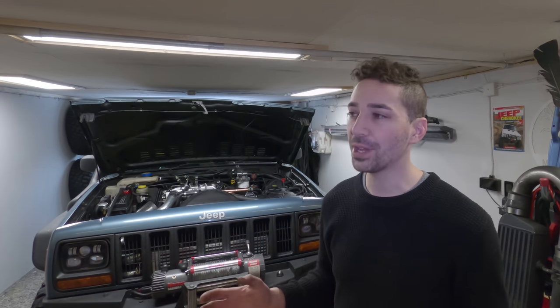That's it for this video - mostly about putting in the vibration dampening and sound deadening, but I wanted to show what the vehicle looked like afterwards from the perspective of someone who doesn't run any carpets and just runs mats. The foam on the roof will make it look a lot better and help with insulation too. If you're in a dry country with no water worries, just chuck the carpet back in, don't use so much product - just put a few sheets to take the resonance and vibration out of sheet metal like the doors.